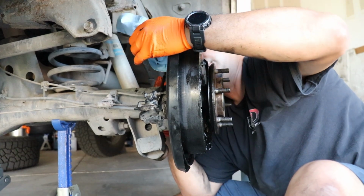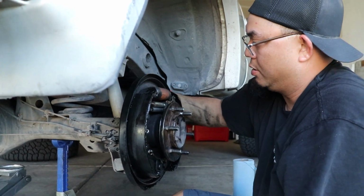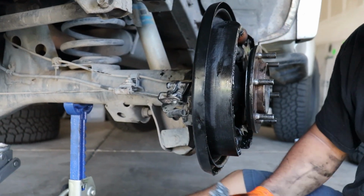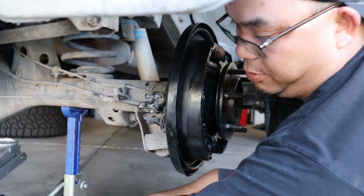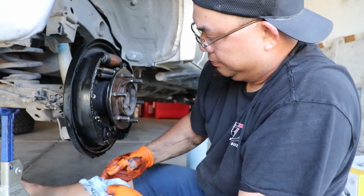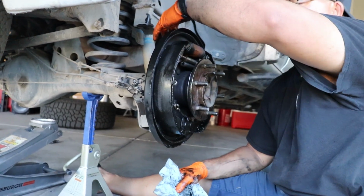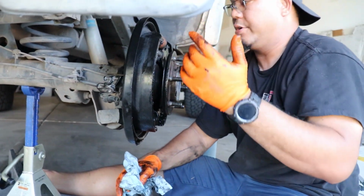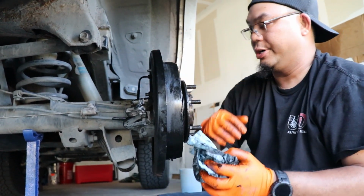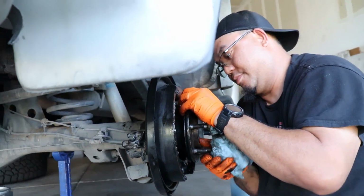So again, as we start to let it bleed, it's gonna bleed some of that air, being that the inline is lower than the bleeder. Should force the air out pretty quick. If this was an RS or a lot more of a sporty vehicle, I would definitely be pushing through all the bubbles. But on something with a drum brake system that was consistently letting fluid come out through the line, I'm not too worried about it. There's no chance of air getting through the system. It's always been bleeding pressure out. So that does make me feel a lot better about it.